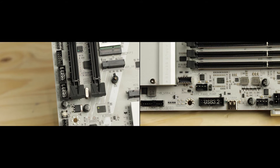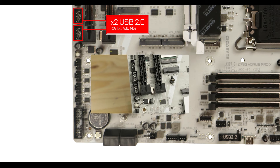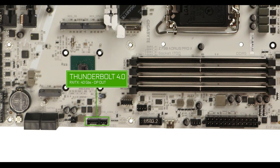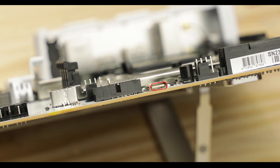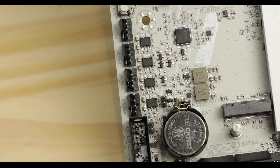The good news is on the front panel connector side we have more than usual. In addition to dual legacy USB and 5 Gb/s front panel connectors, we also have a dual-channel Type-C at 20 Gb/s, a Thunderbolt 4 card connector, and — a first for me — a front panel Type-C DisplayPort to feed a sensor panel. I actually like the idea of a large LCD screen in the chassis displaying BIOS sensor information. First kudos of this review.